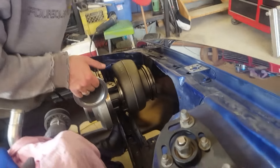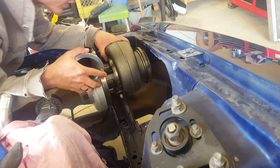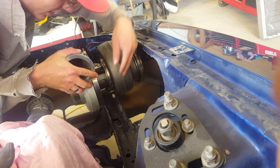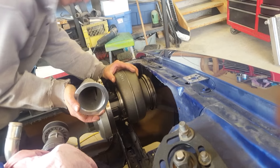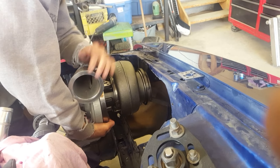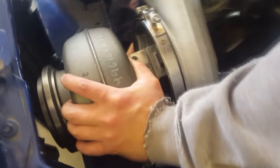Here, twist it. There you go. Do you think it'd go like this, maybe? Well, it could. And then where does your exhaust go from there? It would have to go like a 90 down and then a 90. Because then this could go straight into the firewall. Yeah, that would work. You want the exhaust on that side of the frame rail. Seems like a lot of room to me. You have to go down and around the wheel.